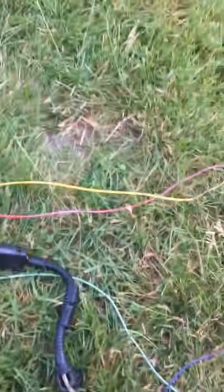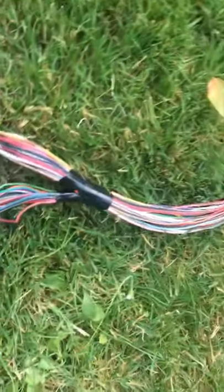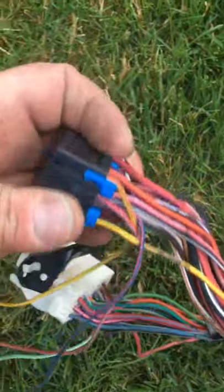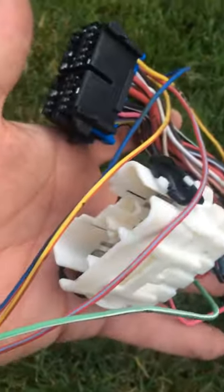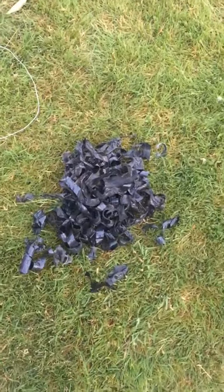Now that I've pulled the wires out, for all intents and purposes here is our cruise control wiring harness — plug to the servo. We know where all our wires go, they're all labeled, we have the ones with pins and all the pins. Then we have the deconstructed wiring harness — less cruise control — which we will reconstruct. We now know which pins we need to remove from the two internal plugs to add them to the inside of the Jeep. That's a big pile of black tape that all got removed from our deconstructed wire harness.